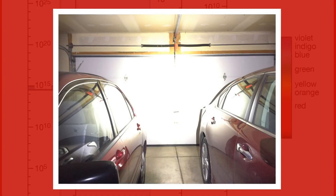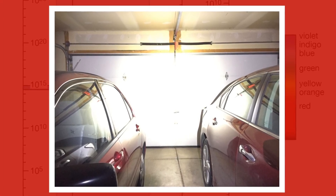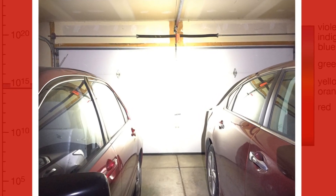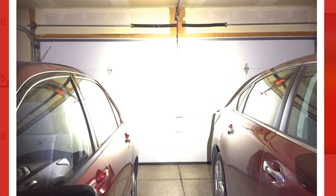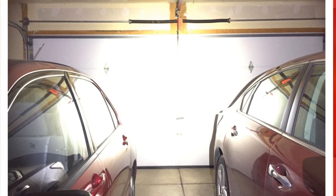This first picture, the light's on turbo. Yes, super bright — it's amazingly bright. I am 15 feet away from the garage door and this is the brightest flashlight I own. They rate the turbo mode at 2,000 lumens at one and a half hours runtime. Of course it's going to throttle down if it overheats or if your voltage starts dropping. They do say this will reach 300 meters — that's quite a throw.